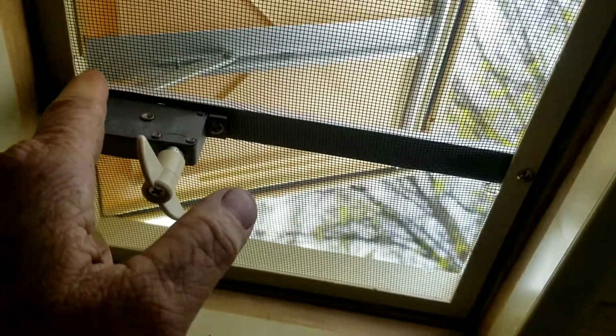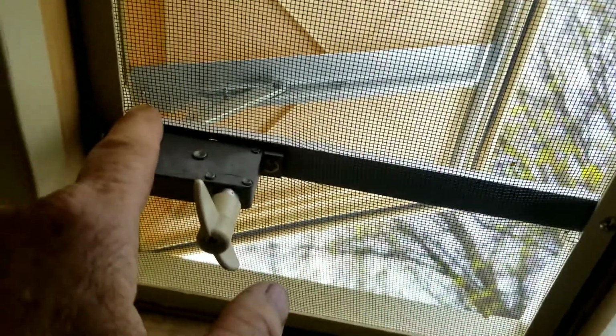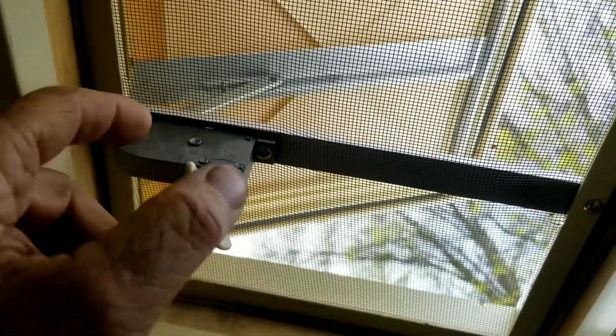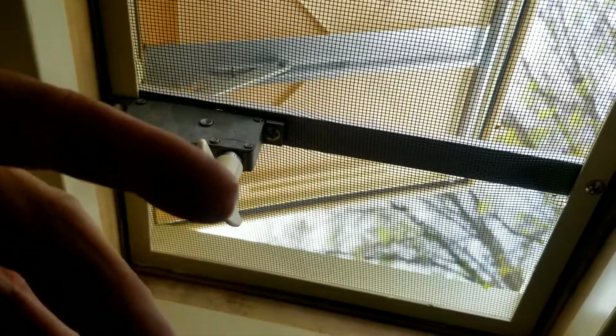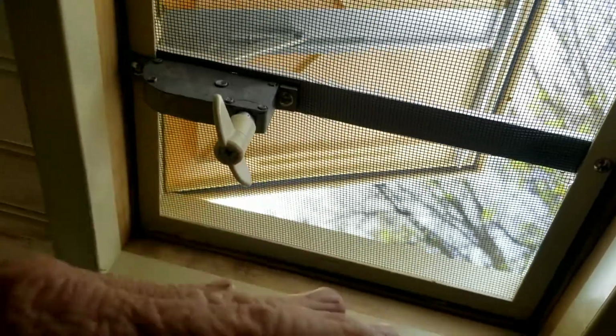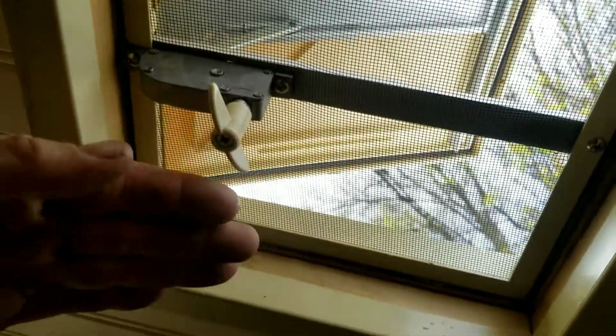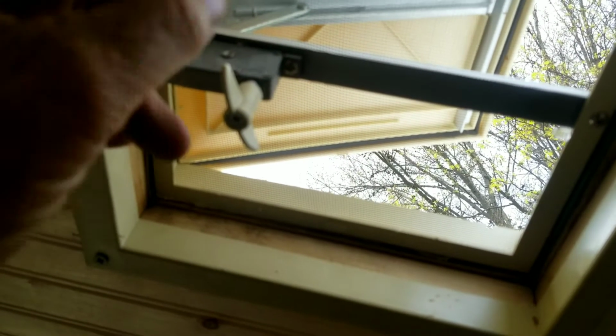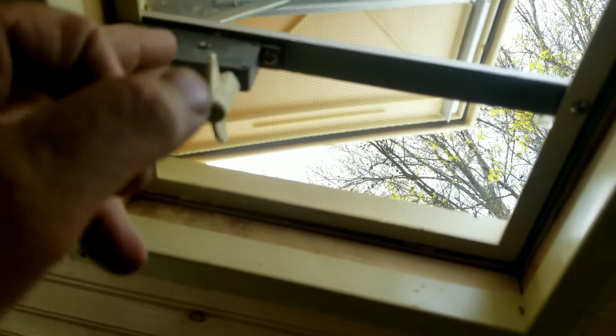But you see the cross brace that goes across that lifts this up. There is a small rivet right there. And as long as the camper was sitting level, the water would hit the rivet and run off. But I had it at so much of a slope, as the water would run across that vent, it would go under the rivet and through it.